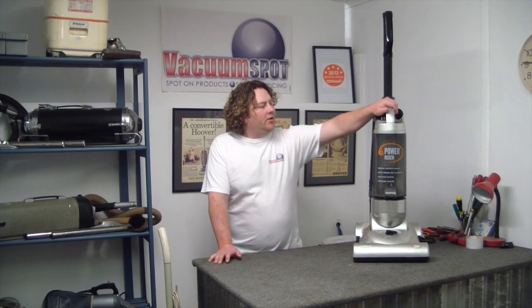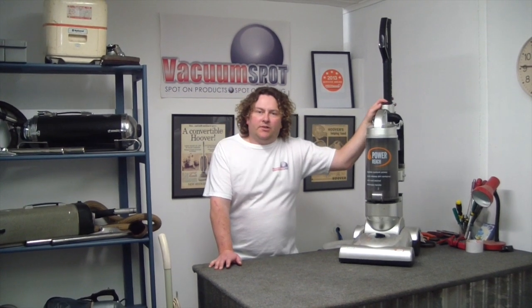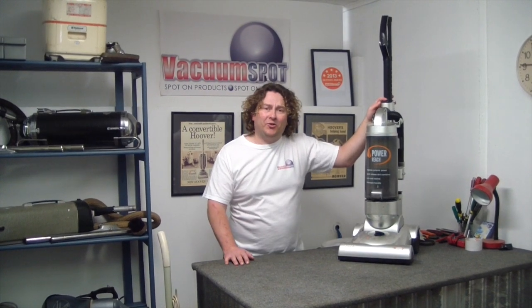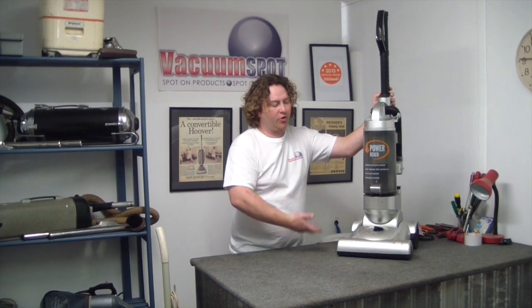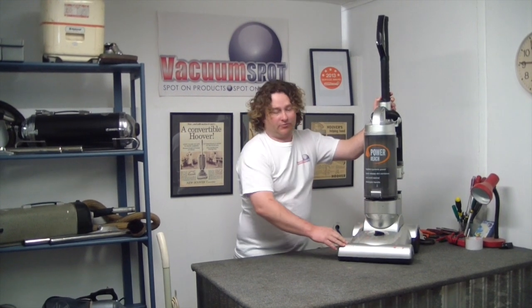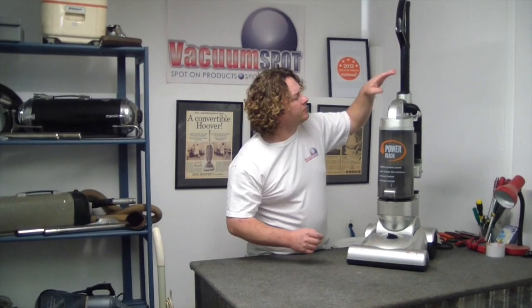Going to do a quick video on a Vax Power Reach V043. This particular machine has come in because the customer said it just doesn't pick up. I had literally a 20-second look and I agree with her, it really wouldn't. There are two things that are going to be critical to performance on this machine. One is your filter and the other one is the roller actually spinning, and in this case neither are going to work properly. Let's have a look at the filter first.